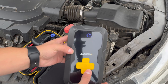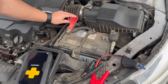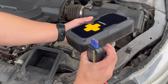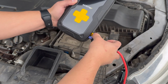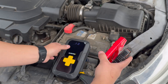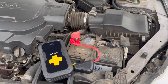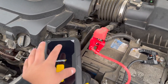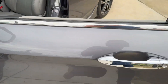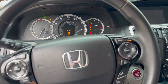The device is at 100% charge, so we're good to go. On this Honda Accord the battery is on the right side of the engine compartment, with a red cover for positive and black for negative. We open the cover on the side of the Auxito unit, insert the adapter, then connect the red clamp to positive and the black clamp to negative. After letting it sit for about 30 seconds, we go to the vehicle and try to turn it on — and look at that, it started, right in real time.